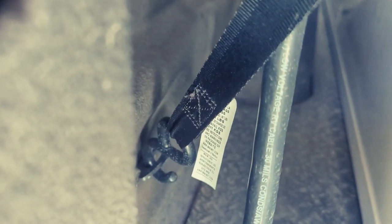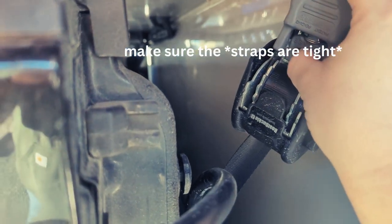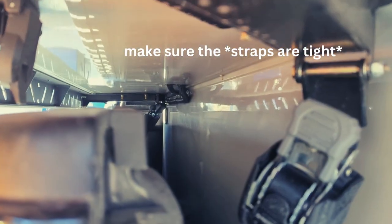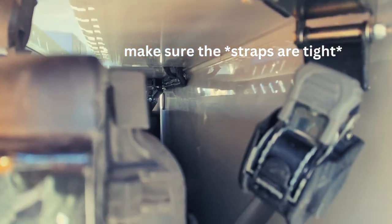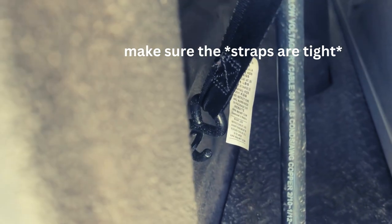One of the other important ones is the anchor points in the bed. I am using the stock Ford anchor points right here — there are four of these. You want to have four anchor points in the truck box to secure the camper down. These are ratchet-style tie-downs: you can loosen and tighten them, and you want to do this for each and every trip — just double-check your ratchets to make sure they stay tight into those anchor points to hold the camper down.